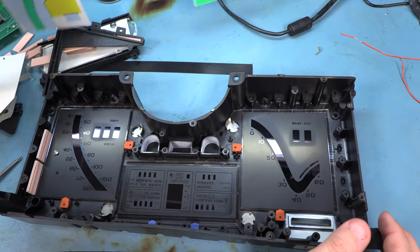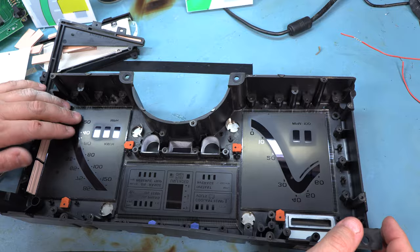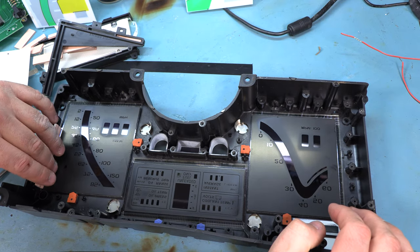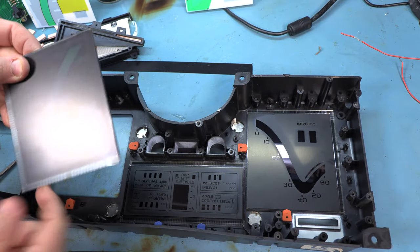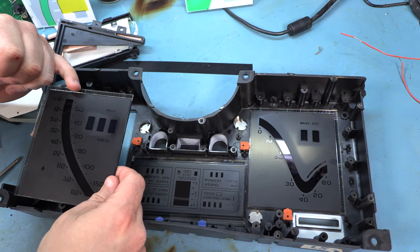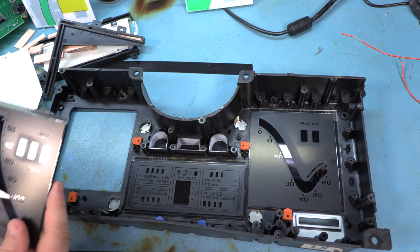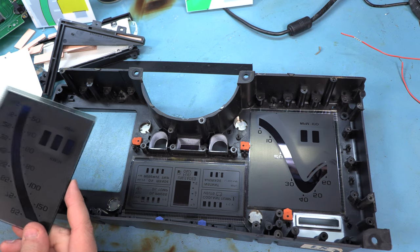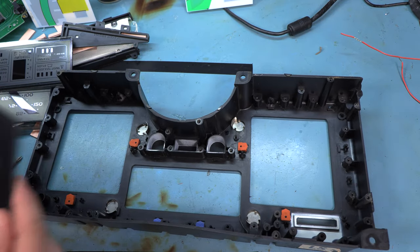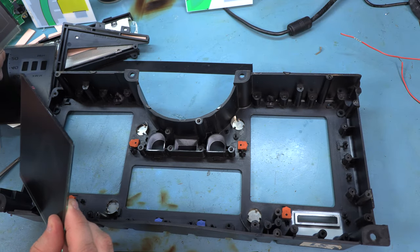I'll set the light diffusers aside. Looking at these panels, we do see a broken piece of plastic — we're going to get that out of the way. The customer has not replaced the polarizing film on these. With non-working segments, another thing I would check is to be sure that the polarizing film is trimmed flush with all four edges of the panel. If the polarizing film sticks proud of the glass on any side, it can cause these electrical contacts to not align properly and segments to not work. I'm also seeing some dirt on the glass surface. I see no cracks in these panels. It actually does look like the polarizing film has been replaced on this panel — we can see an uneven edge at the bottom, but the film is not proud of the LCD, so I think it's okay.